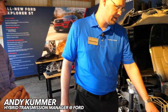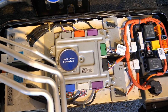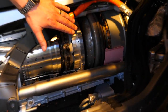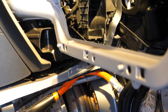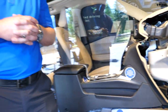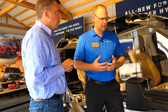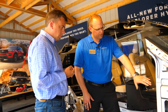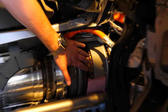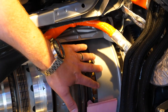So what we have is a 3.3 naturally aspirated engine paired with a 35-kilowatt high voltage battery. We drive our vehicle with our 10-speed modular hybrid transmission, which is based off of our 10-speed architecture out of Livonia Transmission — the same as our base 10-speed in the rest of our Explorers. We have 90% part commonality between the two transmissions. The electric motor is a 35-kilowatt motor paired with our 35-kilowatt battery — about 44 horsepower.